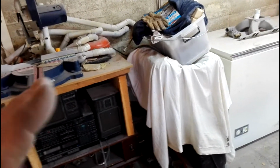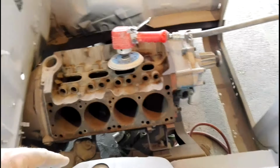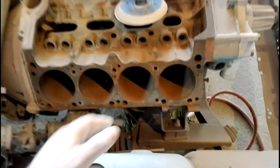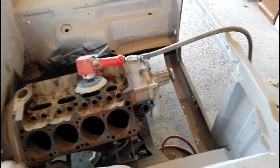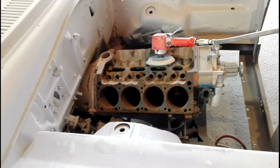Once I've got them reasonably well situated, we can bolt all that stuff back in there, and I can work out how much I've got to tweak, because they work quite tight in here, but those angles aren't quite right. Those tubes, instead of being 90, might need to be 92 or 93, just to get that bit more clearance, and that's all fine tuning when you're getting back into the steel. But anyway, back to where I was here.